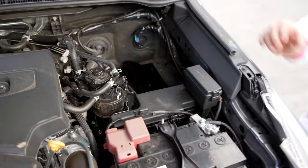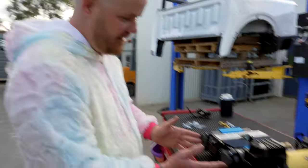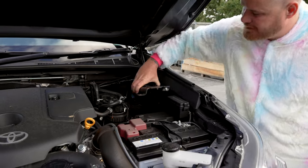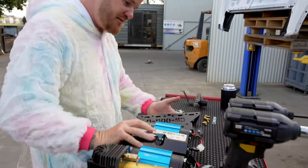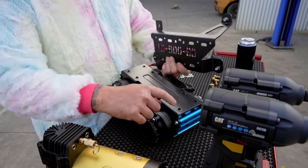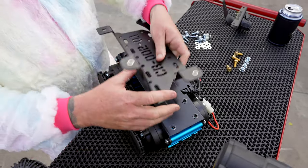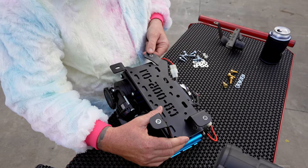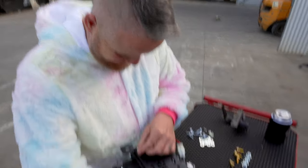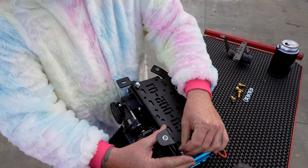So that's how it's going to go. You're going to want to put your ARB air filters - these bits here - pointing back into the engine bay towards the driver's side. So I want it like that. He's put it upside down. You can see under here we've got all these nutserts from ARB that we're going to utilize to mount with. We've been mounting to a lot of things. We've got M6s out - we've cut the holes for these. Put this bad boy in here. Remember, get everything in nice and loose before you tighten anything up.